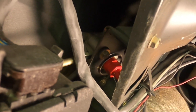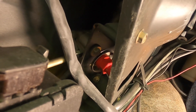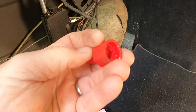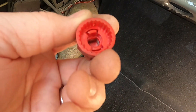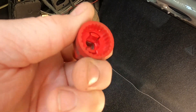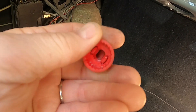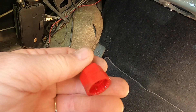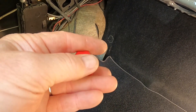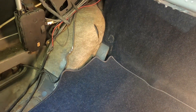According to the manual, that little red cap comes off of there, and you can get in there and make an adjustment, so that's the next thing I'm going to try. All right, that's the red cover I pulled off of there. You can see some spring-loaded plastic areas in there where it kind of holds onto that shaft. This is a pretty substantial, heavy-duty red cover. I slipped a screwdriver underneath it and just eased it off, and the shaft is back in there.